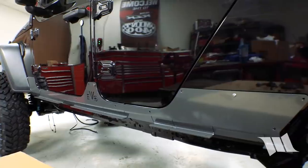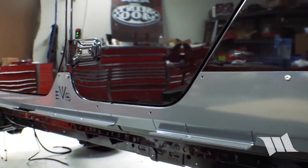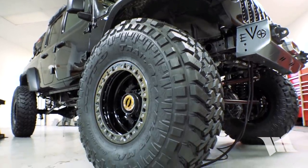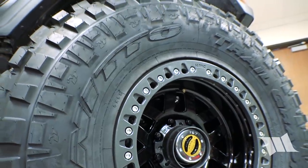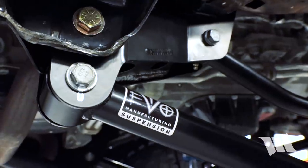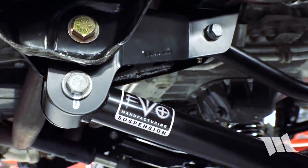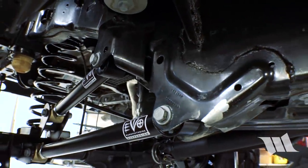We're doing a rock slider right now. We have it set up on 40-inch tires. Since I'm not driving on the road, I went ahead and cheated — we got my race tires on there, so I'm super excited about that. This will climb really good in Moab, so we're looking forward to getting some good pictures out there. We ran a short arm kit and our overland brackets in the front. We knew we were going to be really tall, so overland brackets kind of correct all that stuff. We have all of our adjustable control arms, front and rear.